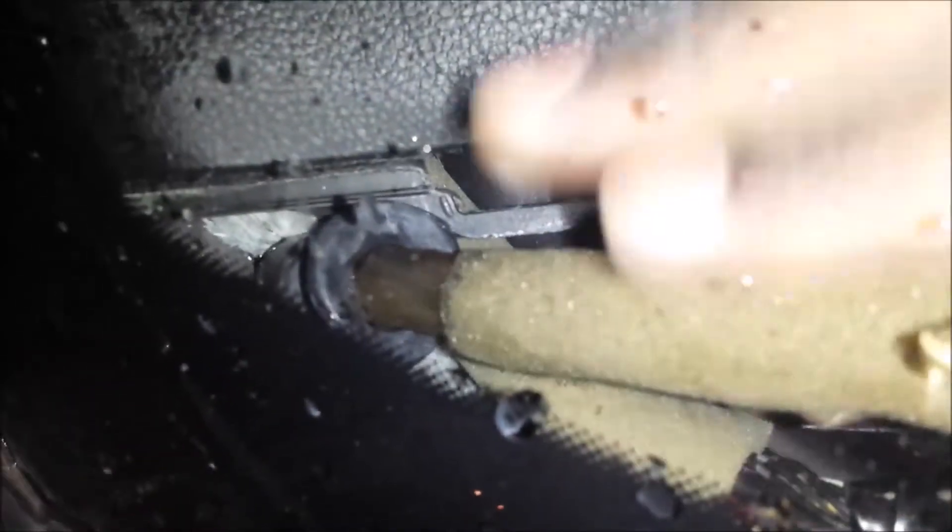This plastic tube is magic. Now that that's done, go ahead and fish the rest of the tube. You're going to aim for the end here, and once you remove the A-pillar you should be able to see where that goes — you see that hole over there? That's where this rubber grommet or drain is going to go into. You have to kind of move it to the side because this piece of the dashboard is blocking it. Then you have some trim here as well. Fish it the best way you can. I'll leave it loose for now just to make sure this thing goes in correctly.